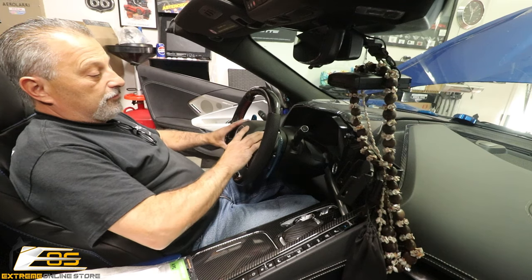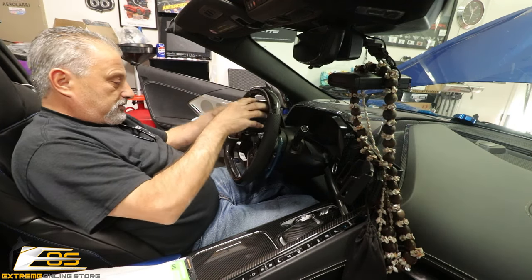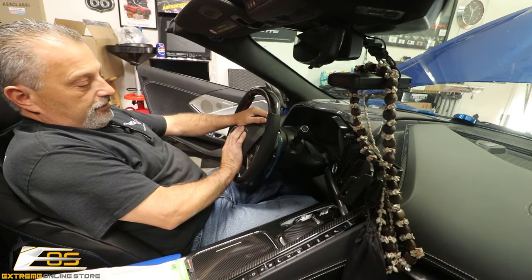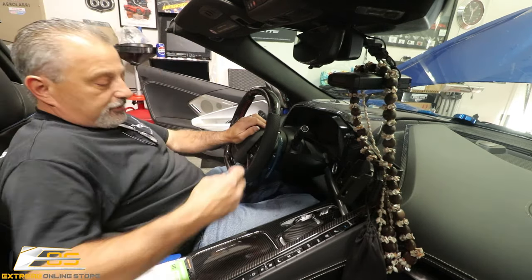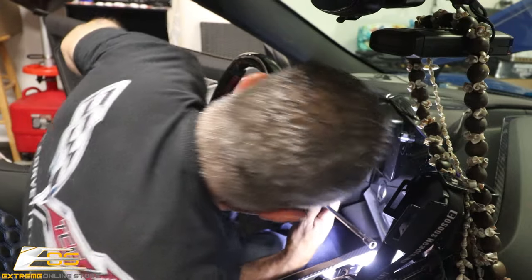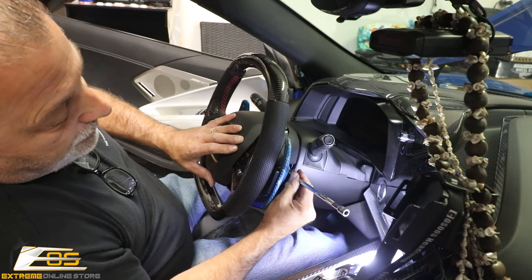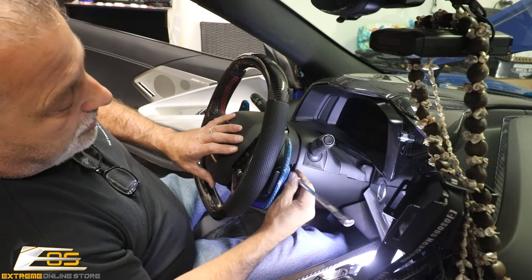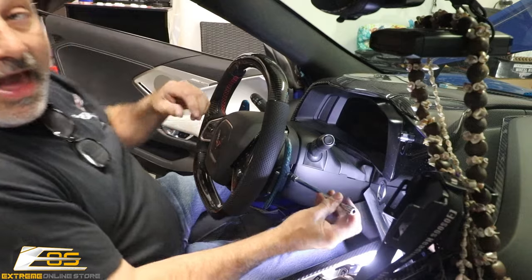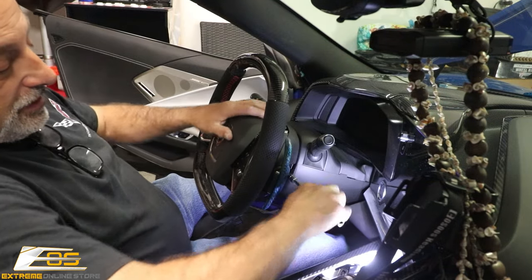At that point this just sits in the hole. Make sure we have no wires in the way. Let's go ahead and see if we can get this to sit down in there. Now we have our two 10 millimeter bolts. Hopefully you can see in here where the screw has to go in — I'm doing this by feel. There's not a lot of pressing and pushing that you should do; if you're having all of that, then you're not getting something lined up right. That's in there — you can see the horn is floating like it should and the screw just needs to be tightened up.